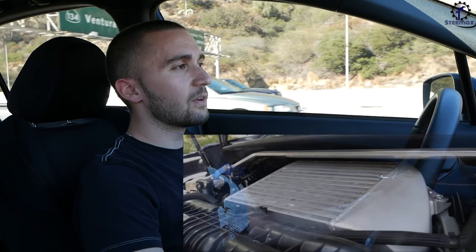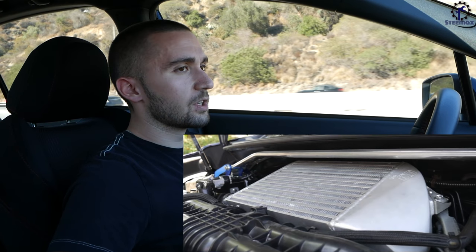For number three I didn't pick a particular brand — it's going to be a top mount or front mount intercooler depending on your power goals. If you're going to go over 400 horsepower, go with a front mount; anything below that a good top mount will do just fine. I have the Turbo XS, and it did great on the dyno. My pro tuner had no complaints — it made consistent power and intake air temperatures are really good when air is blowing through the scoop. Hot charged air is a recipe for knock, which never ends well.